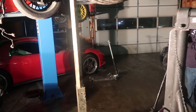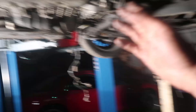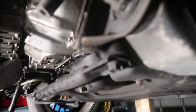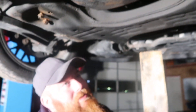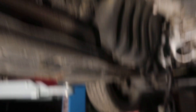So what we had to do to make the trans clear was tilt the engine back. We had enough angle so we could get the engine angled down because all this stuff up here was hitting the top of the trans. The trans bolted in without taking very much pressure at all. What really helped us was literally undoing the motor mounts so there's no tension holding it — we literally had to do two or three small pumps just enough to angle it. So you definitely have to angle it out because the shifter tunnel was hitting it really bad.